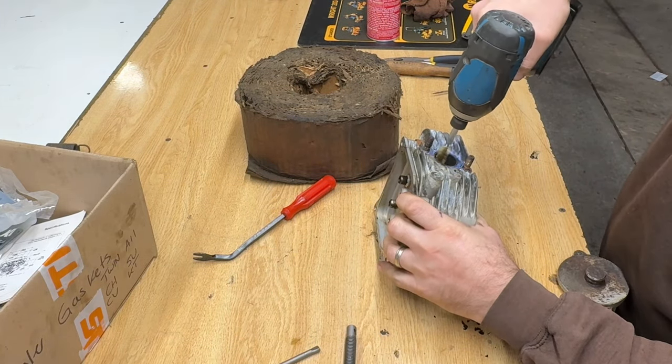Great. Just the air compressor kicking on. All right, so for my exhaust side, here's my driver. That's fine. I'm just going to put some of this coarse valve grinding compound on. I don't know how coarse it is. Briggs & Stratton sells it, and you order from them, you get two pieces, coarse and not coarse.